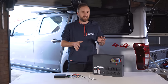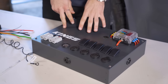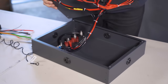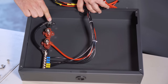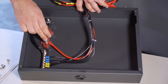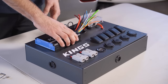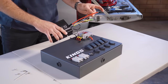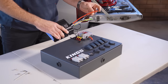I'm going to install it onto the 12-volt control box which gives us all these power options and terminals inside. The steps are pretty much the same so follow along. These are pre-wired inside and designed for a DC-DC charger. Use a three millimeter Allen key to unscrew the lid. Inside the 12-volt control box you've got three terminals which make it so easy — connecting your black, red, and brown wires to their respective terminals means you can connect your two batteries on separate terminals. There's a designed space for the DC-DC charger on the front and a grommet to run all your wiring inside. You'll need to add an eye terminal to the end so it'll fit onto those terminals, and depending on where you mount the charger you'll need to extend the wiring.